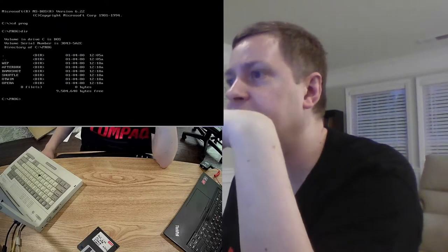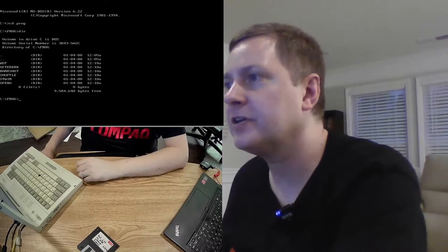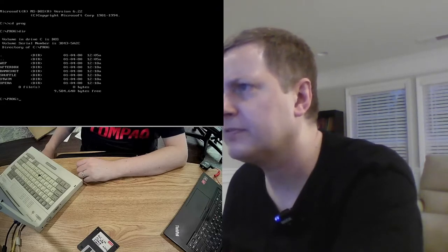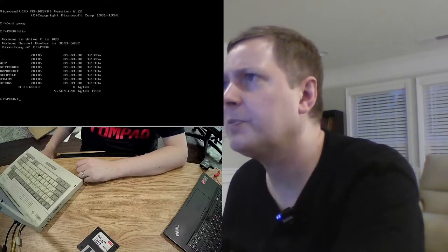It's got an AMD Geode processor. Let's see here, looking at lspci. Oh, VGA controller, Realtek Ethernet, ISA, so it's got an AMD ISA. No sound. Interesting, no sound. I don't know. I wonder what people have done with it.